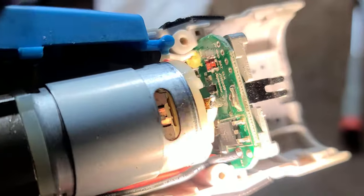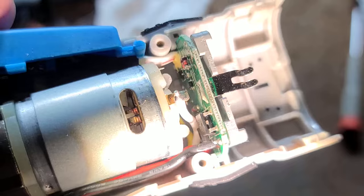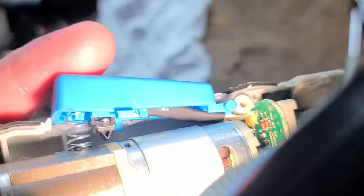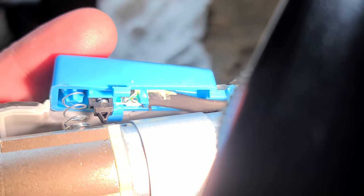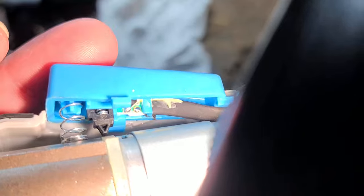Down here is our simple controller where the battery comes in. It also probably cuts off the motor if it overloads or if the battery gets too low — the cutoff may be in that board. It's the variable speed controller. The actual potentiometer — I've never seen this before taking apart a lot of tools — they find some way, maybe even a lever mechanism, to activate a larger potentiometer for variable speed on a tool. But here they've actually integrated the variable speed trigger, the whole mechanism, right into the trigger lever itself.